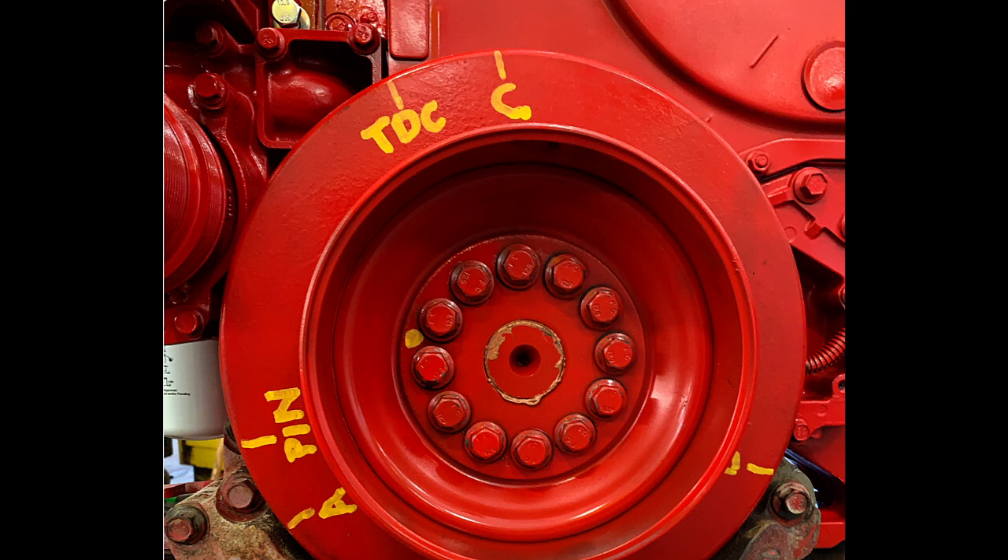I have marked on the face of the damper so it's easy to see. Going clockwise starting at the top left is TDC — top dead center. Then position C going down, position B on the bottom right, position A on the bottom left, and then a little farther up is pin. So when you want to pin the crank, you have to have that pin mark on the damper over at this point right here. There's a small mark on the cover and a larger mark farther up — they're just a ribbed bump on the cover, and those are your alignment marks.